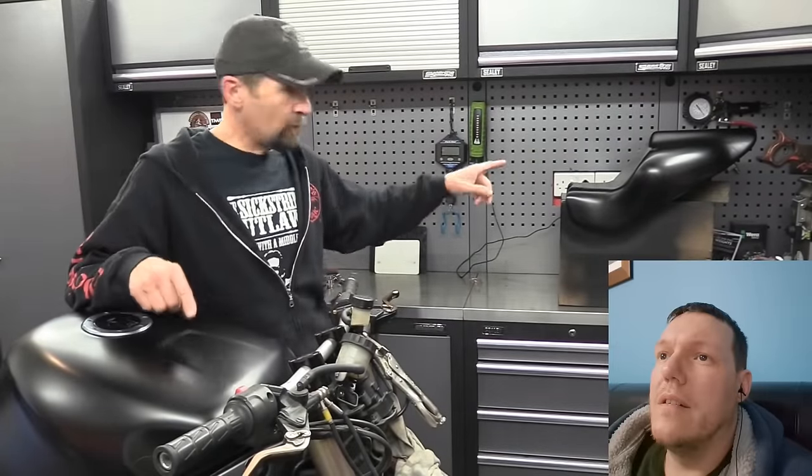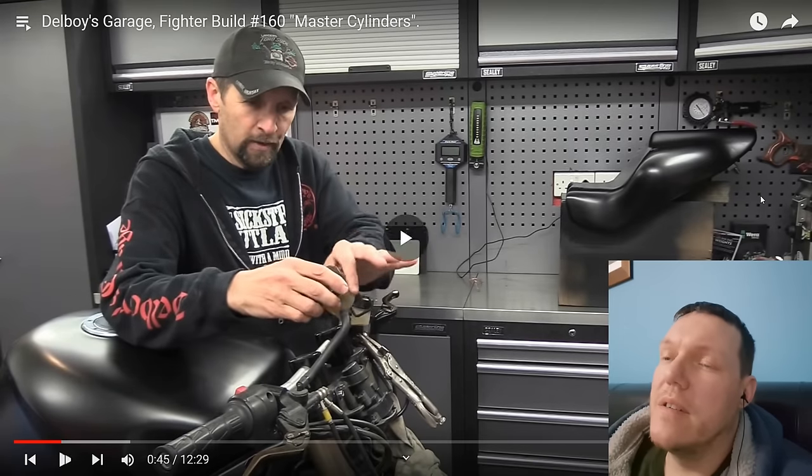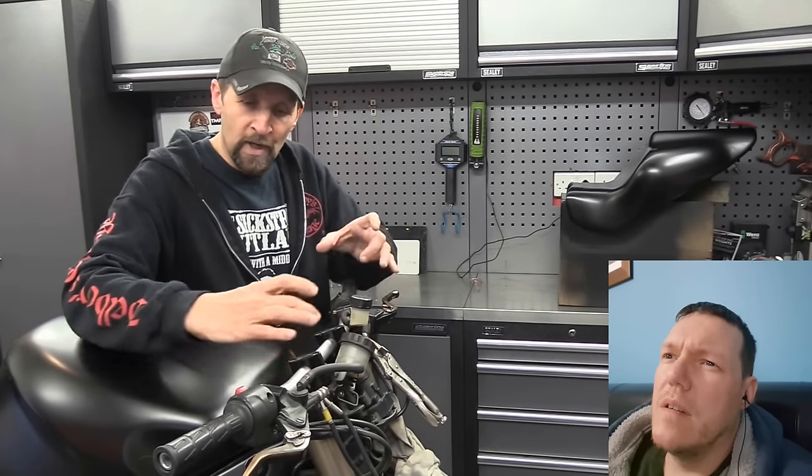Right, good morning, welcome back. Okay, back to the fighter build today. I think the paintwork is done for one lifetime, don't you? Happy to call that done, until we get to the artwork in the new year. Handlebars today, I want to change some of this furniture. I'm getting rid of these plastic fluid pots. I've never liked these really, even on a sports bike. There's a better solution. I do prefer, wherever possible, the cast alloy pots. It's called lighter. I showed in the last video, I've got a pair of those to fit on the bike today, and they are definitely going to be a major improvement to a set of naked handlebars.